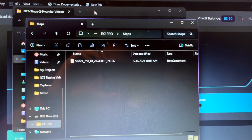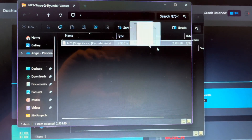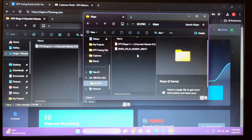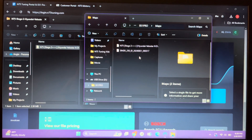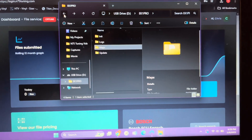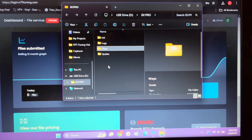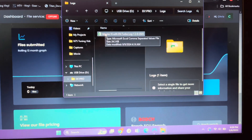Go back to the car. Turn the car on by pressing the start button twice with your foot off the brake — you do not want to start the car. On the EK-1, go to Power Mode, Write ECU, then select the base tune file, then OK to begin the process. Allow the process to complete. This process should complete in a matter of minutes.